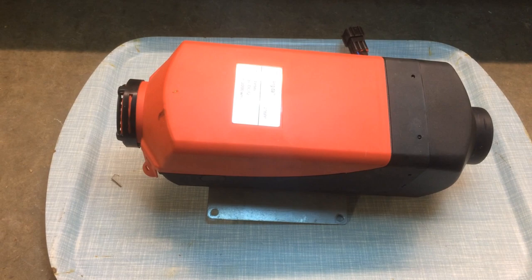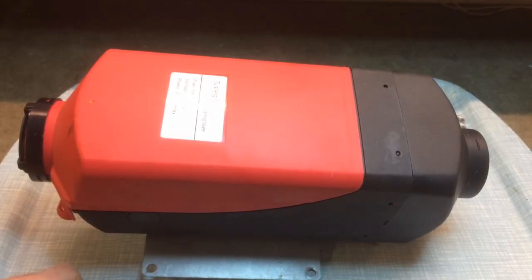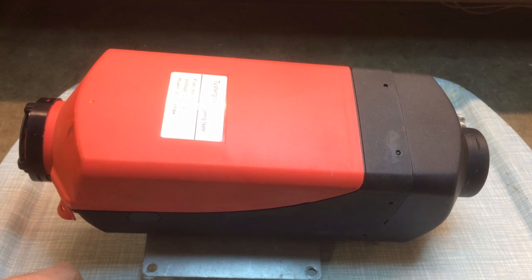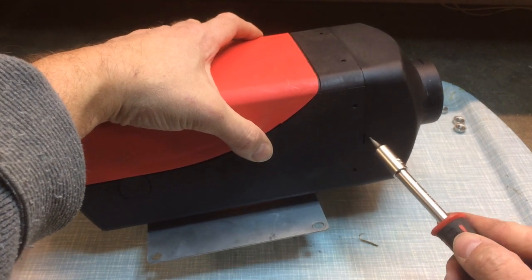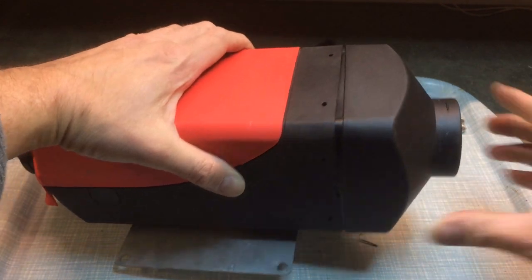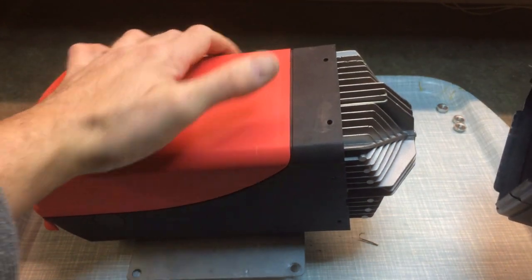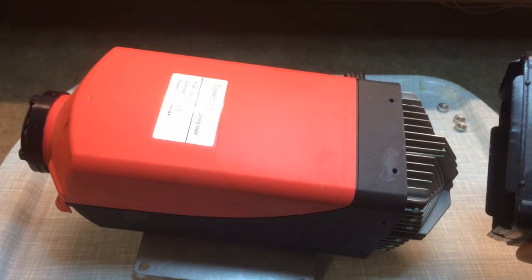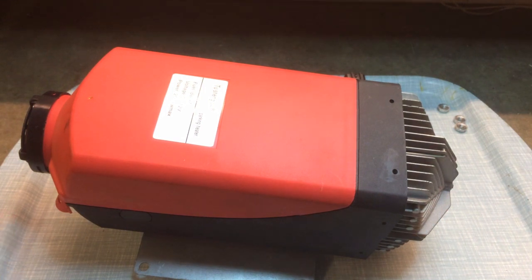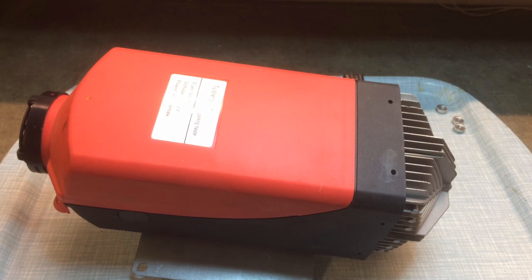So I've now taken it out of the van and it's on the workbench. The first thing we've got to do is take all the plastic covers off — that's relatively straightforward. We're going to take this end piece off with a screwdriver. Push the screwdriver into the little gap and just prise the end off. You might find you need to push the little pins down with a point, maybe a bradawl or something, but on mine it just pulled off nice and easily. This is the two kilowatt, a genuine two kilowatt one — this is out of the camper van.